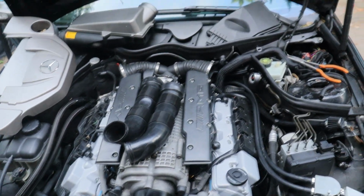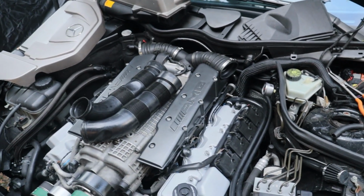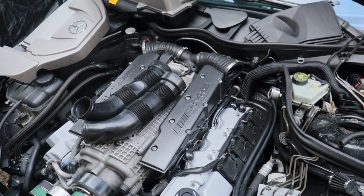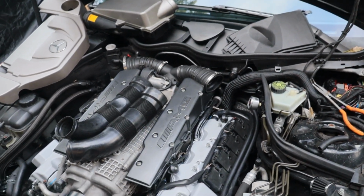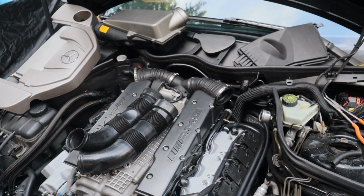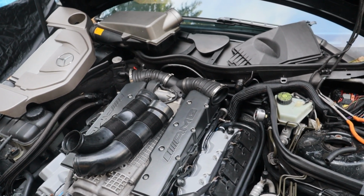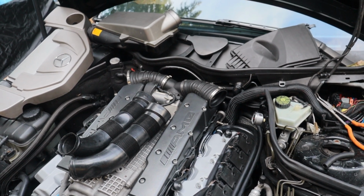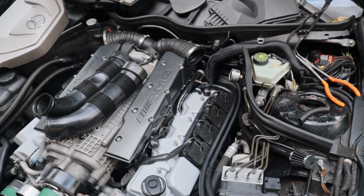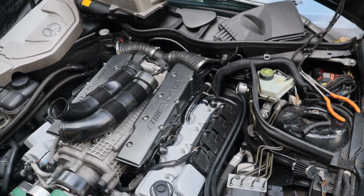What else? Right now I'm going to test the vapor lock issue. I was just reading back on what Josh said to try for that. So I basically said turn the key on, go to the Schrader valve on the rail, press it, note if it's fuel or air, and then cycle the key off, on, and do it again. On the 3rd key cycle, start it. So I got some other stuff to do before I do that, but let's check it out.